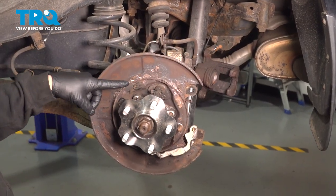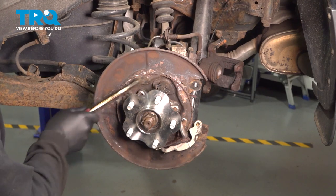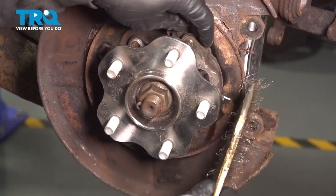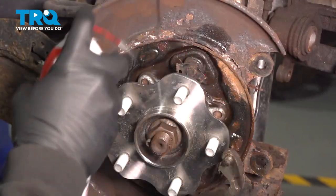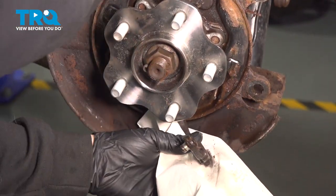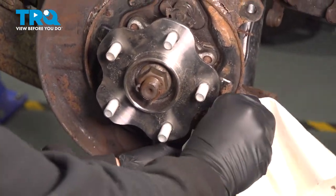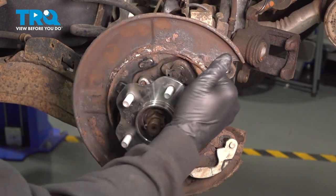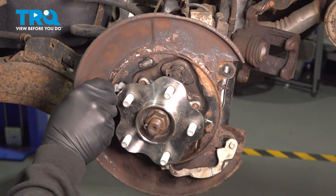On our backing plate there are six contact points that our parking brake shoes make contact with. We're going to use a bristle brush to clean these, clean the back with some solvent, and clean the bracket for our e-brake setup. Then on the six contact points, put a thin coat of grease — this will help eliminate some of the friction.